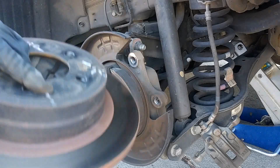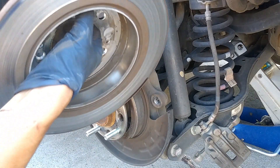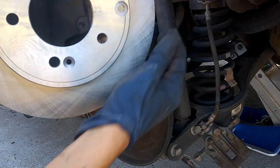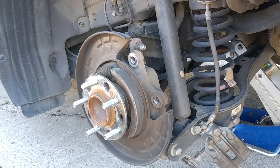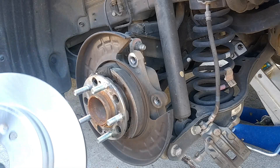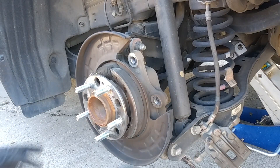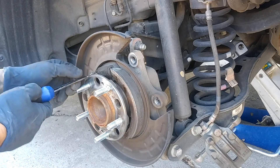These were actually pretty easy to come off. We're going to take off this rubber piece right there — just push on the inside. Then we're going to switch this over to our new rotor, just push it right in like that. When putting on the new rotor, make sure the screw holes line up with the ones on the wheel hub. Since it goes in a bit loosely, our shoes have enough meat, so that's good to go. This is why you'll need the flathead screwdriver.